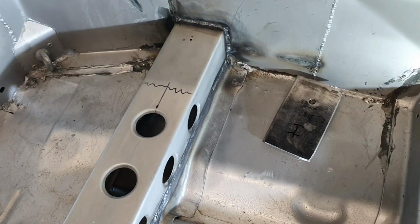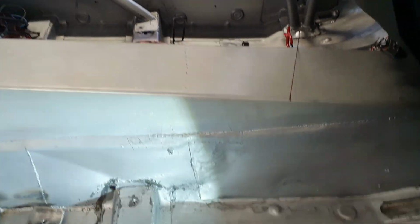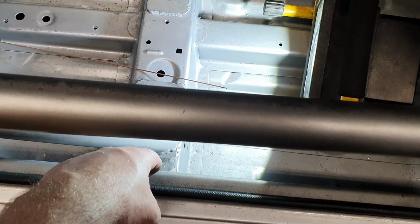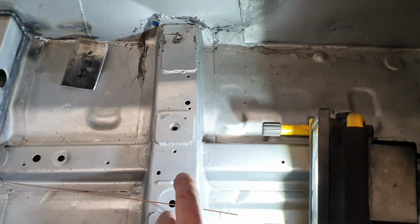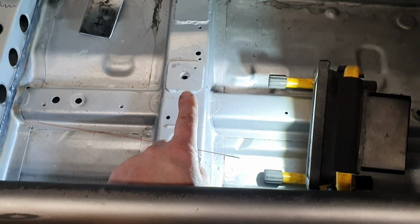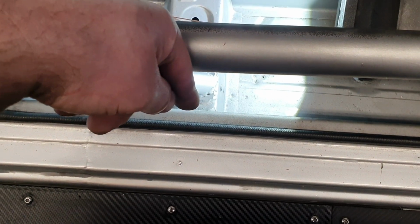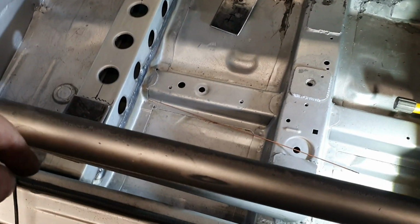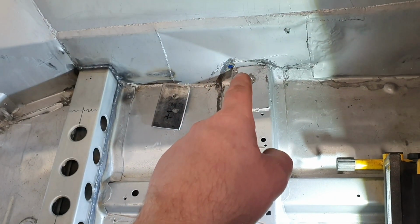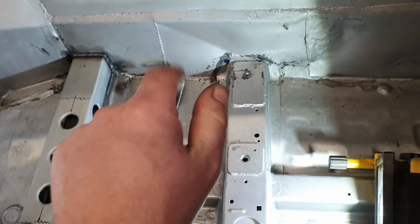Same on the other side there, and then we'll measure from the sill, which is parallel to the other sill. They don't taper in and out or anything silly like that, so that's handy. We measure from there to that one. I couldn't reach there because my hand was under the harness bar. So measure this point, that gives us that distance. Same with this other one, and then we've got to make sure we're actually square, make sure the whole lot's not like this, something silly.